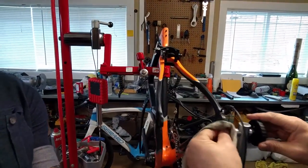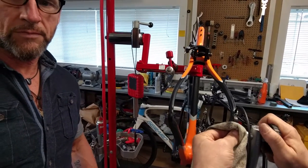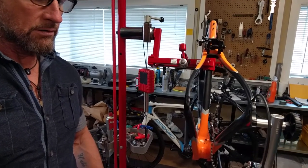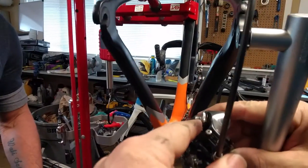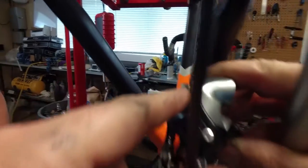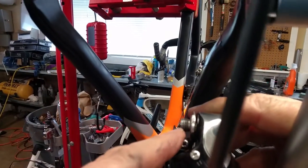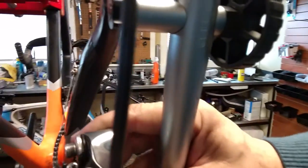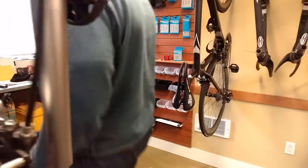You mean they're over-tightened? No, they're cross-threaded — you cross-threaded it at some stage. You can see that the threads on the derailleur are pretty snarled up — not nice, sharp, and fine. When I saw that earlier on, that said to me there's something wrong. We'll just have a look — let's see what it says with the wheel in.